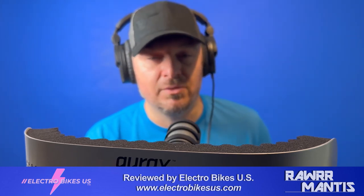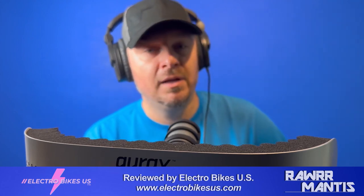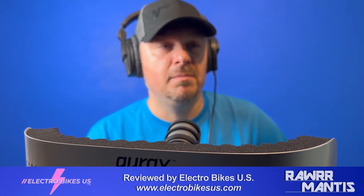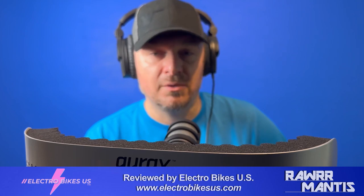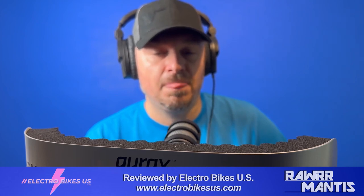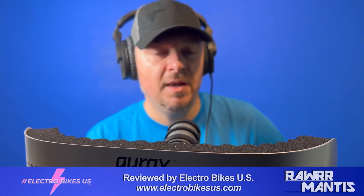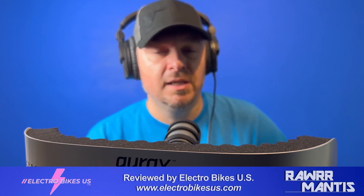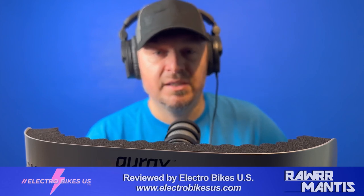The Mantis brakes are not quite motocross brakes — more like heavy-duty downhill mountain bike brakes, somewhere between a dirt bike and a mountain bike. They work better for me than what's on the Talaria stock. The MX3 had notably soft brakes, and some reviews say the MX4 with the bigger rotor still feels soft. The Mantis brakes are full four-piston hydraulic caliper, and the rotor size doesn't feel undersized. The rear will lock up quickly — just as quickly as the Talaria.